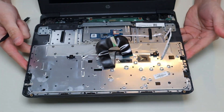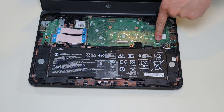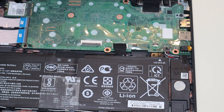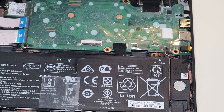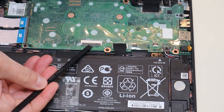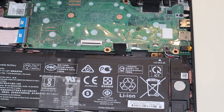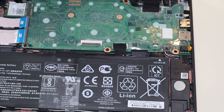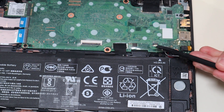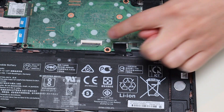So that's how you get your palm rest off. The large ribbon cable from the keyboard went here, and the small ribbon cable from the touchpad went there. You've got to be very careful because the clips are very fragile — if one breaks you most likely won't be able to find a replacement and your ribbon cable won't ever be secure again. The way to do it: you slide it under the black clip and that pops it up. It opens almost like a book cover. After unplugging it, I like putting the clip back down for safety so it doesn't get caught on anything. The smaller one has a white clip but it's the same thing — pop the clip up, take the ribbon cable out, then put the clip back down. Again, very fragile, be very careful.